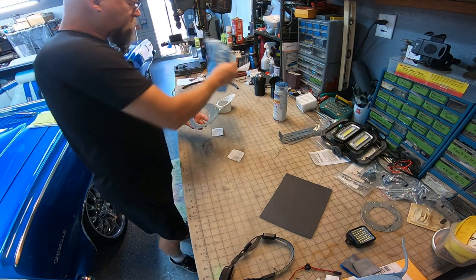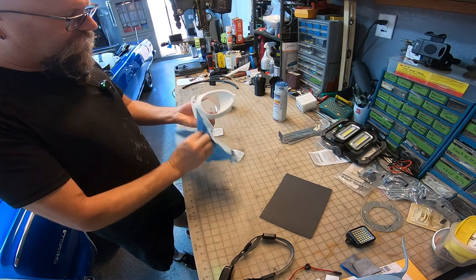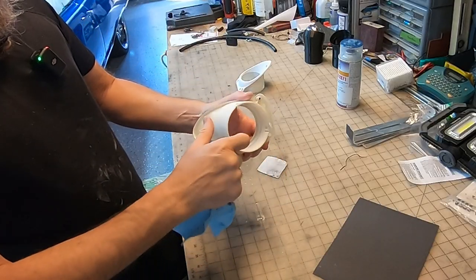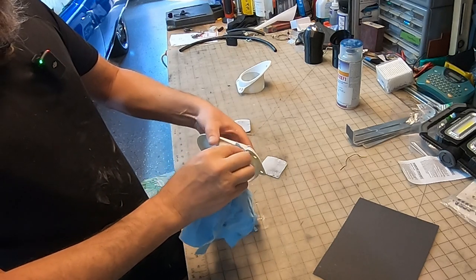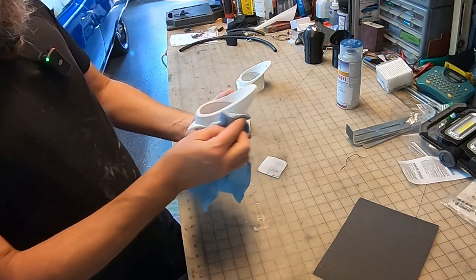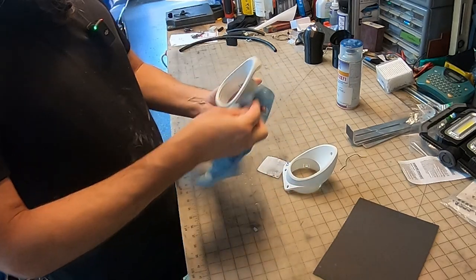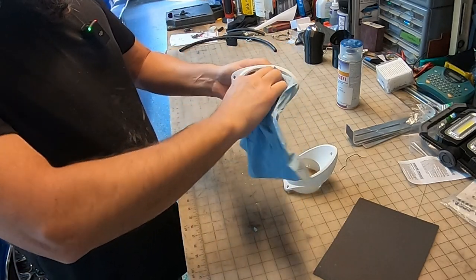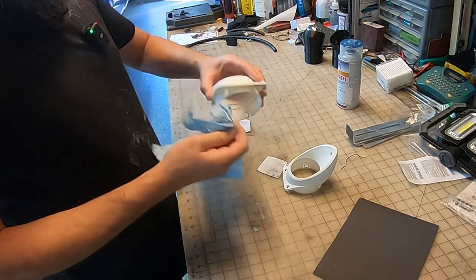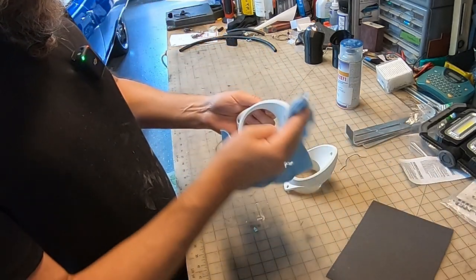And now we're going to wipe them down first and get the main dust off of them. And then we're going to wipe them down with our degreaser, get them nice and clean. And then we're going to spray them with some color. I did sand the back. These are surfaces that will come in contact, so I didn't want a buildup of primer that's going to interfere with reinstallation. So I did sand down the inside barrel, pretty much removing all the thickness of the primer. Just getting the majority of this off, and then we're going to go to a microfiber rag and our degreaser and get this really cleaned up before we put it back outside.